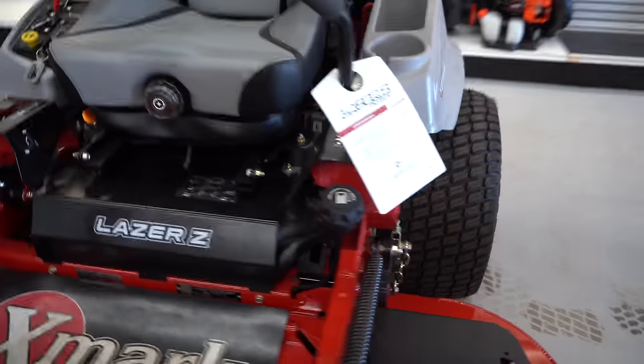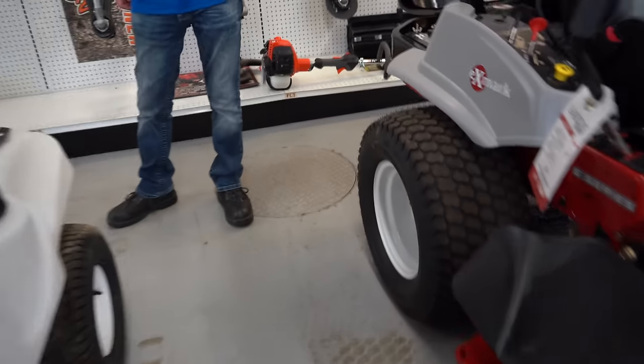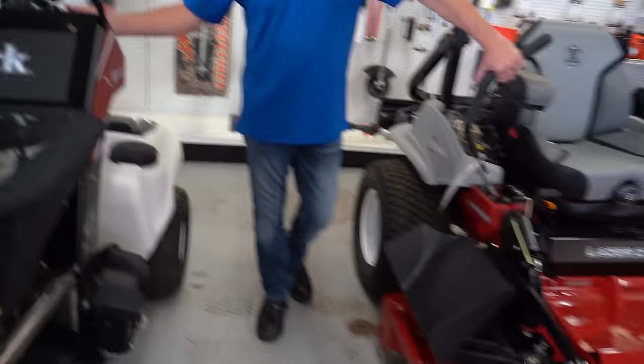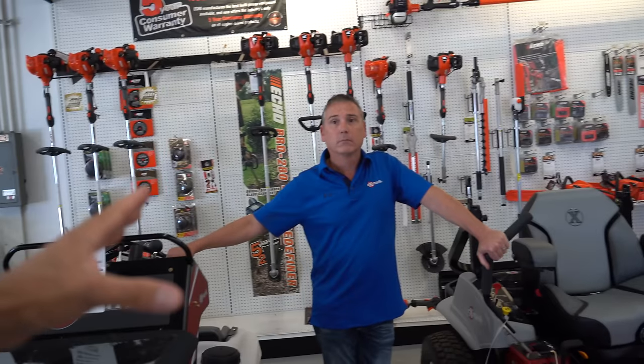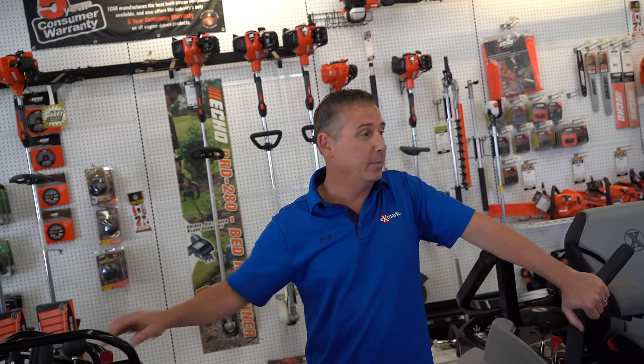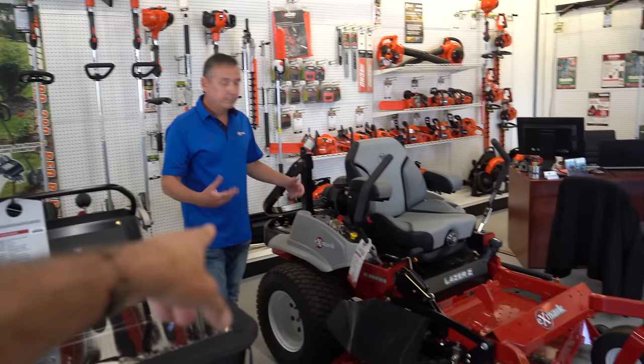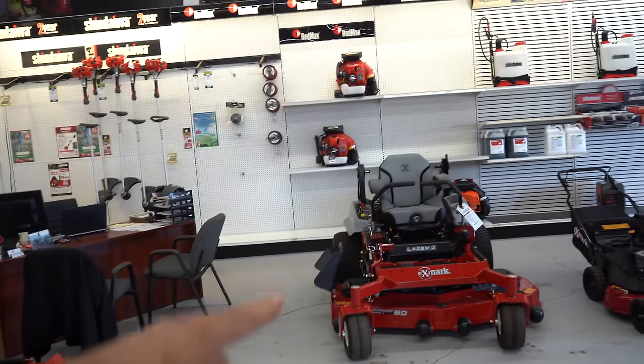You can see the number marked on this tire — that means this one was 73 inches in circumference. Sometimes the marking gets wiped off. If guys go out and randomly replace a tire and the new one happens to be 71 inches, even though they're putting the same size tire on, it may not have the same circumference. It says it's the same size on the sidewall but that doesn't necessarily mean it actually is. These two tires are the same model and they're two inches off. Over-inflating on a 90-degree day expands the tire, and when you bring it back down to 13 PSI, it's still a bigger tire.